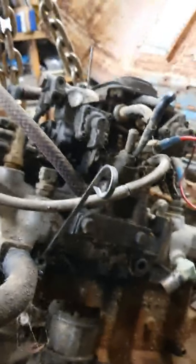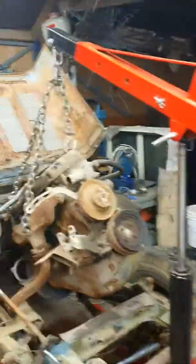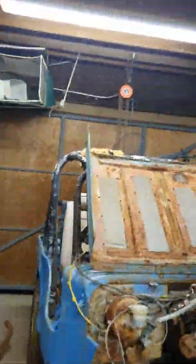All part of the fun with bog trucks. I want to go through all the vacuum lines and I'll probably rebuild this carb while it's off because it's been sitting for so long. I could put the Holley on it but my old man said Holleys were no good for this setup on this truck, so I'll go with what he said - he ran this thing for 10 years or more. I'm pretty much taking his advice and redoing what they did 10 years ago but with more modern gear.